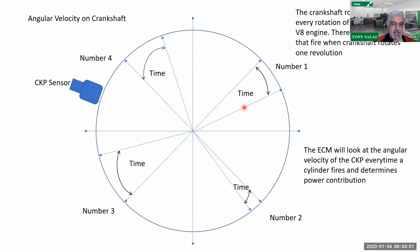So his job is to continuously adjust that. Why am I putting this up here? I just saw yesterday, as I was preparing for this, a bulletin talking about how you better look to see if the truck has off-road tires. In other words, the vibration from the tires, they're saying, can actually mislead the actual timing and quantity codes. And I'm like, that talks about a sensitive thing. It kind of surprised me GM would put that out, because for the longest time, even when I taught gasoline fuel injection back in the day, there was rough road logic. They used to call it rough road logic. So if you go in very rough terrain, is that also going to affect it and cause false code set?